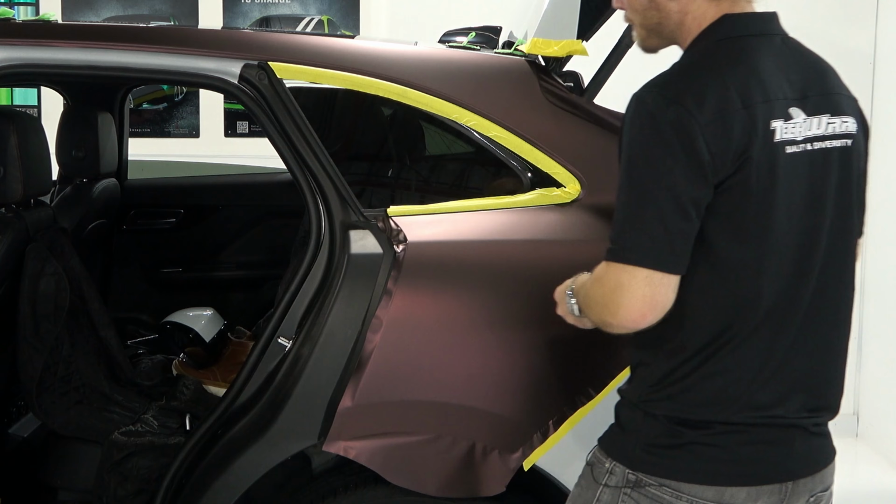That nice little space there. We don't need to tuck in a lot of vinyl, just want to tuck in some. But if you can't tuck in more, go for it. Okay, let's take that. And then let's go right around here. I'm gonna come really close, but leaving myself about 1/8 of an inch to tuck in, maybe more, 1/4 inch sometimes. Try and keep it straight. Again, it doesn't matter, no one's gonna see it.